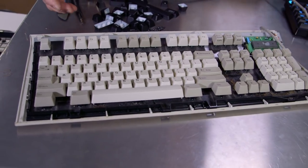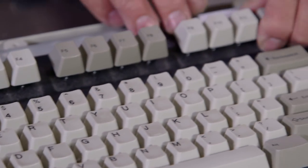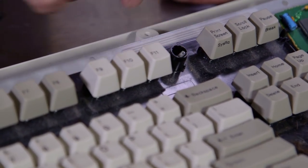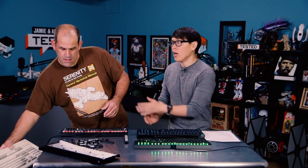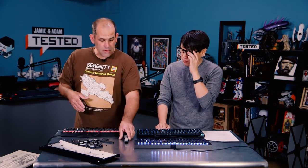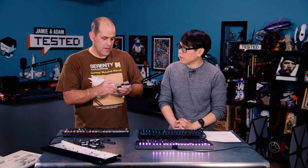You can buy these refurbished for $180 — Unicomp makes them new for around $85. That's the crème de la crème of 1984 technology. 30-year-old technology that still works great for typing. Today a lot of gaming keyboard companies want to design their own keys. Even though Corsair uses Cherry switches, they've developed new switch types for gamers — eliminating the distinctive clicking sound. The gram weight to actuate a key is around 40 to 45 grams these days.